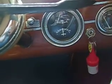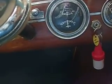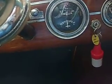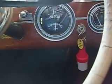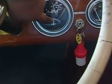We sent these gauges down after we'd been here, brought the tach down with us, and I think we sent the other gauges back. At any rate, that gauge was wired backwards, so it's discharging and it's showing you discharging. We're going to crank this engine real quick — and that is literally how easy it starts. Now we can see that we're charging.